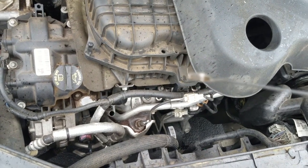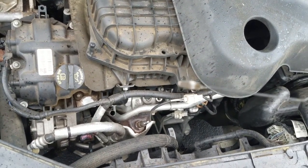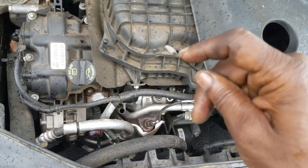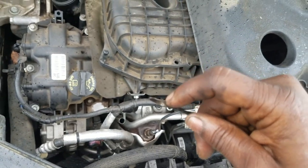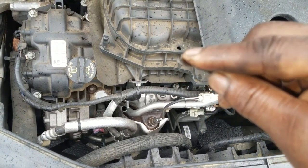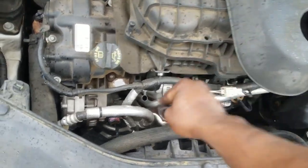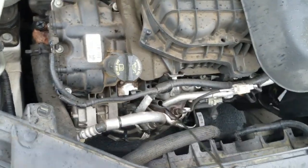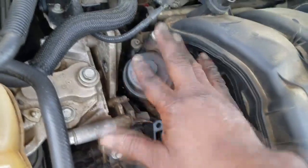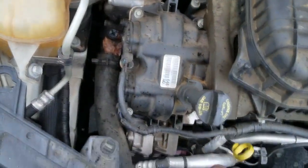Normally the car can run two to three quarts low and appear way down here, but you know there's still oil in the crankcase that would prevent it from seizing up. In this instance, there's absolutely nothing even on the tip, guys. Now most of you guys are aware of the potential oil leak locations on these cars: the oil filter adapter housing, oil pan, things like that. But my concern has just shifted, guys. I will have to find out if this engine is seized.